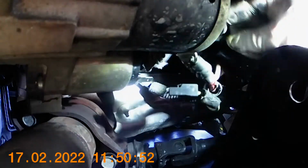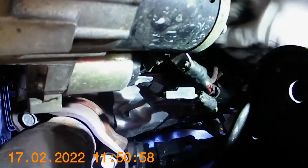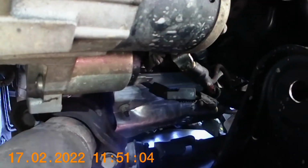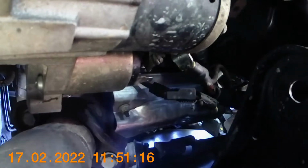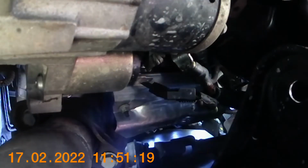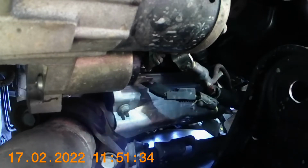All right, let's get this guy over here. What that leak is coming from. I see a little bit of a leak. I was on the Mazda 3 yesterday and I found out the oil pan screws were not even tight. So I had to go tighten them all, so I'm gonna have to do that on here just to check them, because I do see a little bit of oil and it looks like it is from the pan, so we'll just give that a snug.